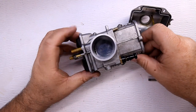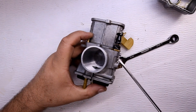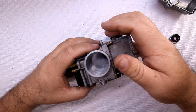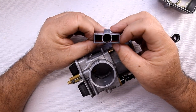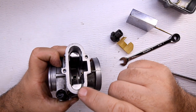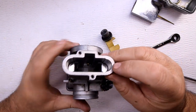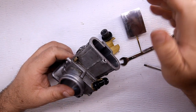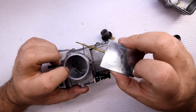If you look at the slide right there — if I turn the screw in, you'll see the slide go up; it's a bit higher now than it was before. If I back it out, it will go down. The slides are channeled — you have these wings on the side that go inside there. These screws hold the chrome blocks on each side. The channel allows minimal air bypass, so air only flows where it's supposed to.